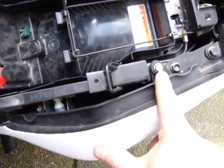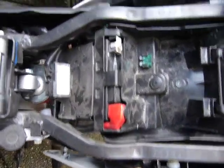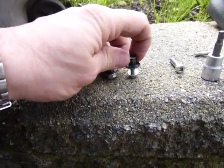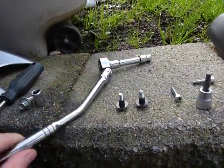Once you're done with that, the next thing to do is remove some bolts on the fairing here. That one has been removed on the other side, and that one has been removed on the other side. There they are — that's how they look. Don't lose this little metal shim that they go through. And to do that, you're gonna need a 10mm socket.